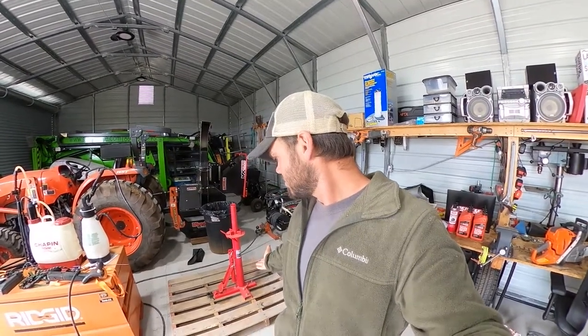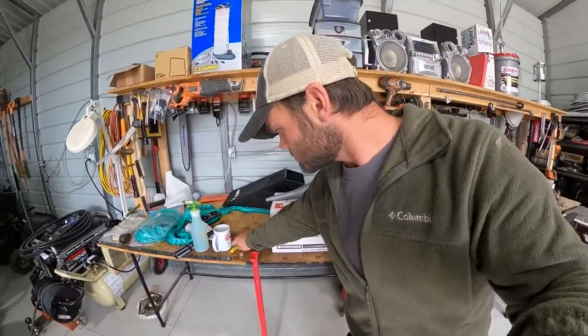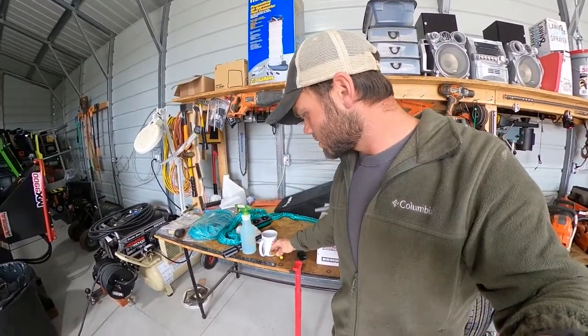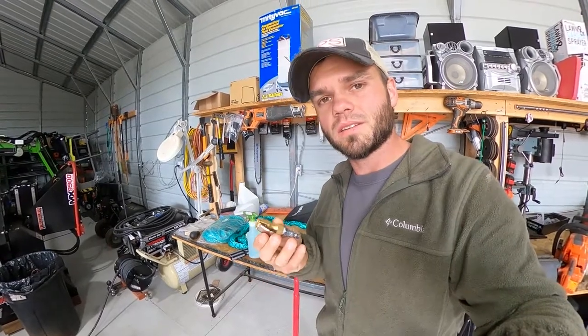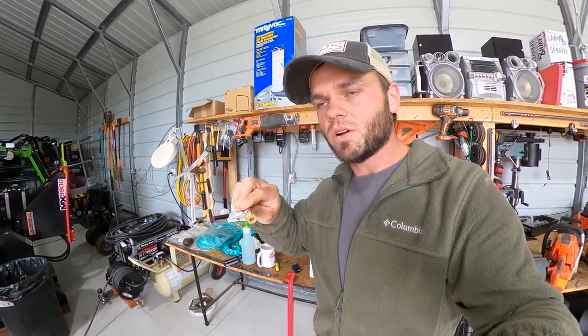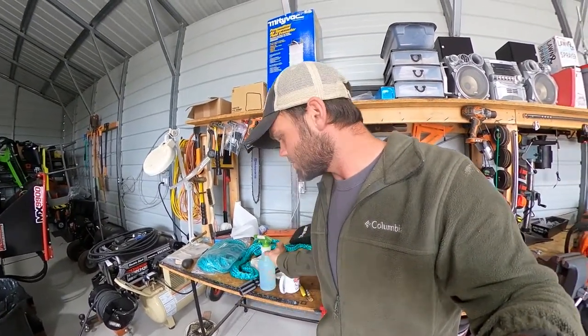This video is about how easy it is to replace a tire on a trailer. This is my Harbor Freight tire changer — you're going to need that. You're going to need a bead blaster, a valve stem removal tool, and an air tool that stays on. This will help you seat the bead because it'll have air continuously going into the tire. You're going to need some tire spoons, some soapy water, and obviously a new tire to put back on.